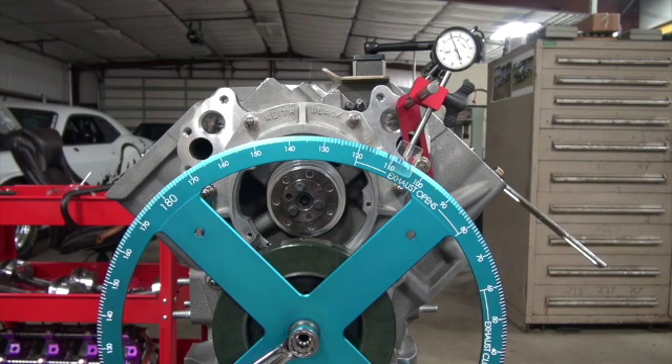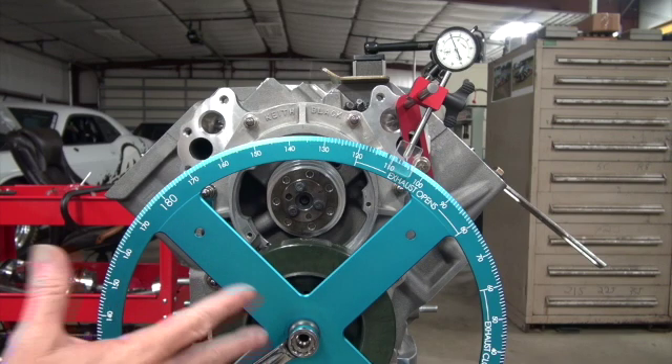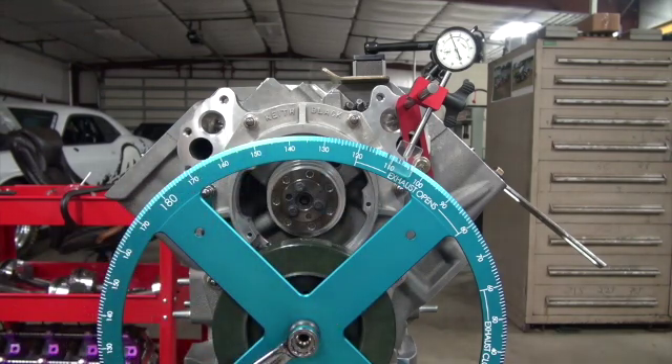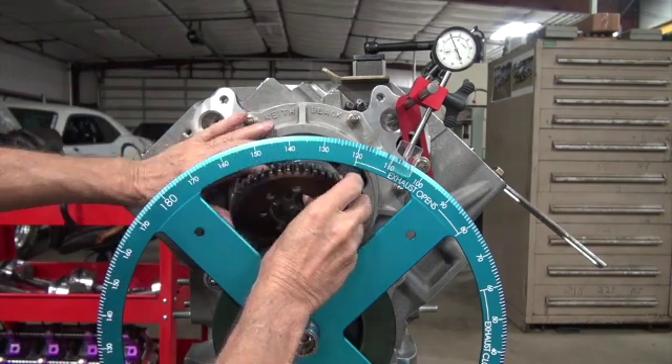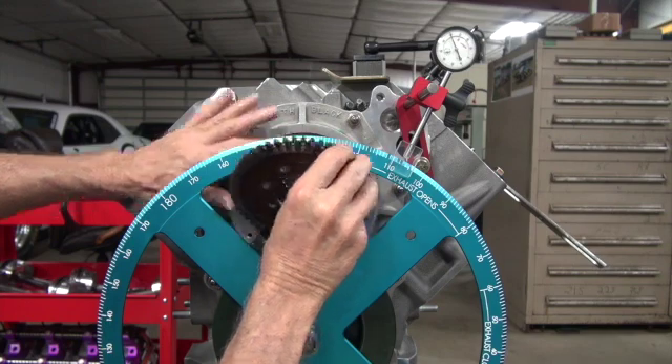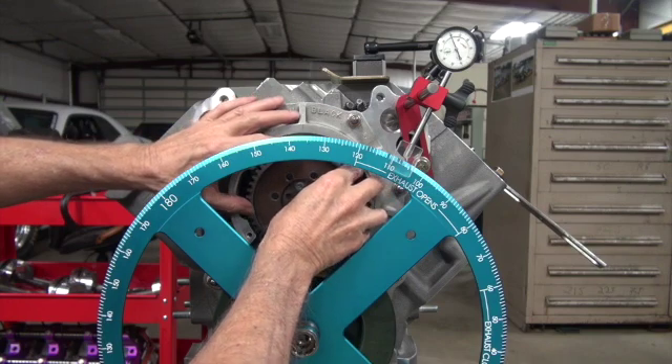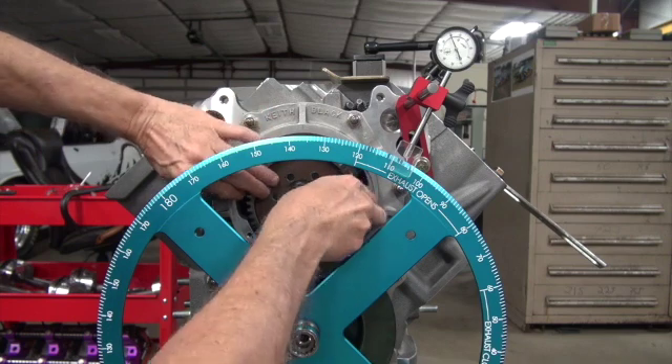Now reinstall the cam gear, just like we did last time, without moving the camshaft or crankshaft. That sounds easy. So what we're doing now is what we just did a while ago — we're going to find the right hole. We've only got seven spots here, so all we've got to do is find out which one. You folks have the best view; I can't actually see over here on the side.